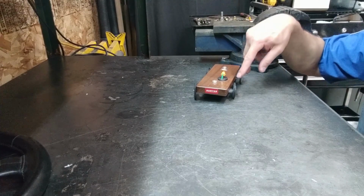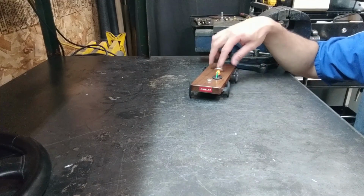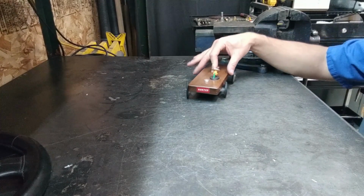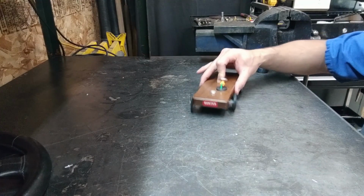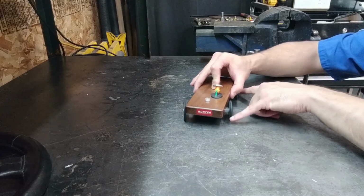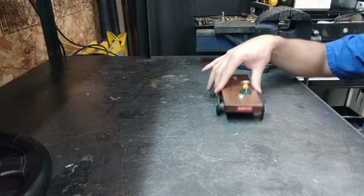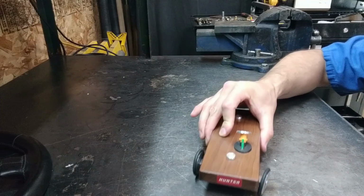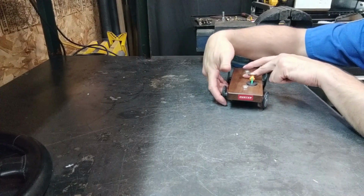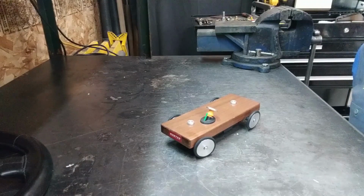So in this example, if the vehicle is turning left, the inside wheels will be the wheels on the left side of the vehicle. So if the system detects that the vehicle is going outside or is steering less than the intended direction, applying these brakes during an understeer event will help pull the vehicle back into its intended direction. Same with the right turn. If during a right turn the vehicle is understeering, then applying the brakes to the inside wheels is going to help bring the vehicle back into its intended direction of turn from the driver.